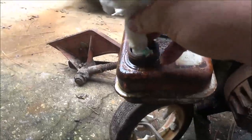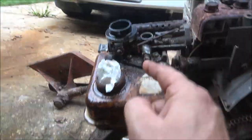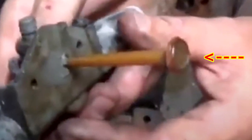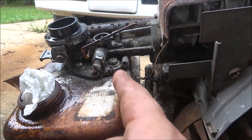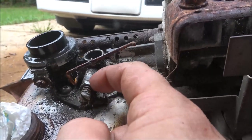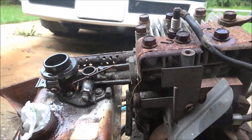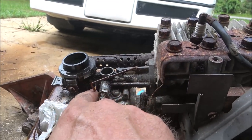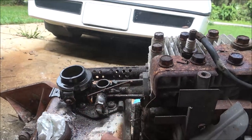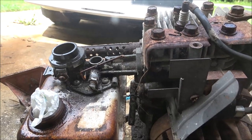It's pretty nasty down in there. I'm going to spend a little time to clean this out. This carburetor would need rebuilt. Really the only thing to rebuild it: you've got a tube that goes down to the bottom into the tank — sometimes that gets gummed up or falls off, and some of these they don't make the tubes anymore. Inside of here there's a diaphragm that's really your fuel pump to pump fuel up. Once it pumps fuel up in there it's got a little well, and that's what it sucks the fuel out of. The pump pumps it up into that little well — it doesn't actually suck it clear up from the bottom of the tank.